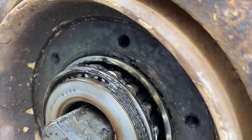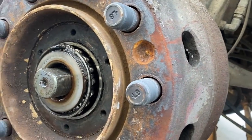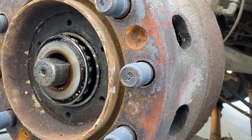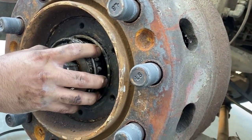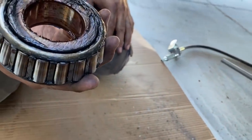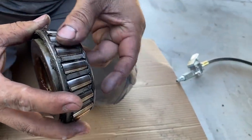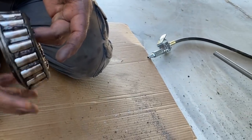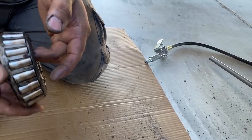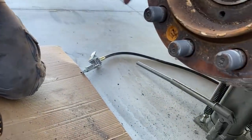There's almost no grease at all on this bearing. The outside nut was super loose — maybe like 25 foot-pounds or less. We're going to go ahead and grab that bearing and pull it out. Boy, that thing has had some water and some heat — oh yeah, it's had some heat to it. See the color? How's the race? It's extremely dry — rub your finger on it, you get no grease at all.